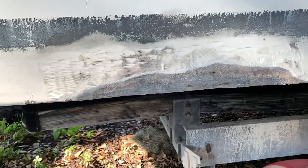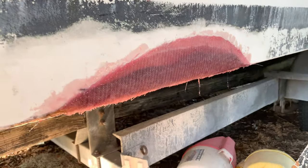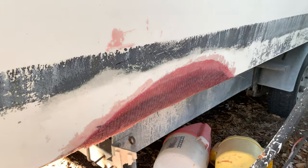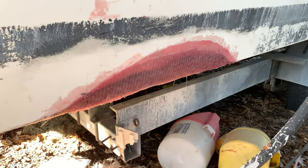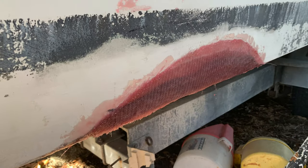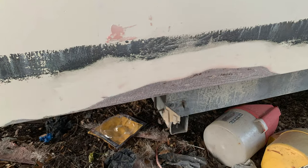On the glass, we started from the smallest piece possible and then worked our way out, just building the layers out so that everything ended up nice and even at the end. It ended up taking 8 layers of actual glass — a mix between some 1708 and some chopped strand matting. We alternated it one for one, and that was the final build-out.